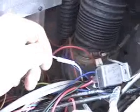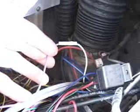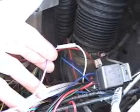If this air door system did not need the ADK, and the installation instructions tell you how to determine this, this violet wire would simply be connected to the door input on the warning light flasher.